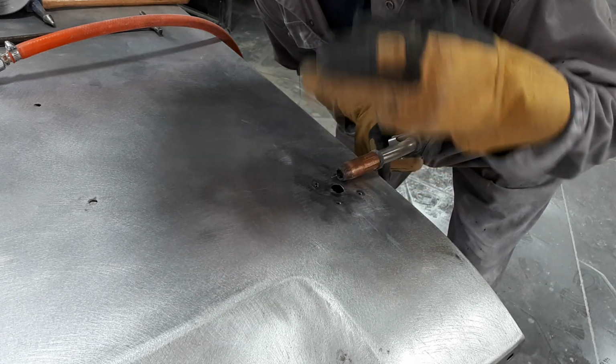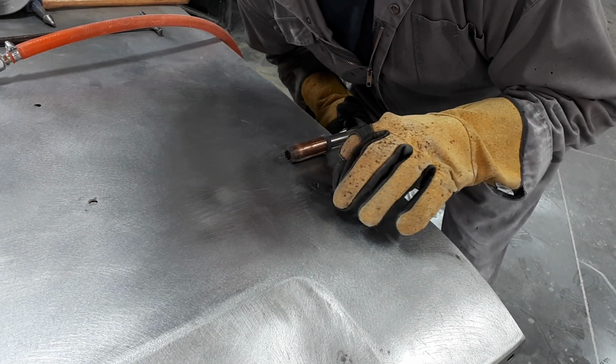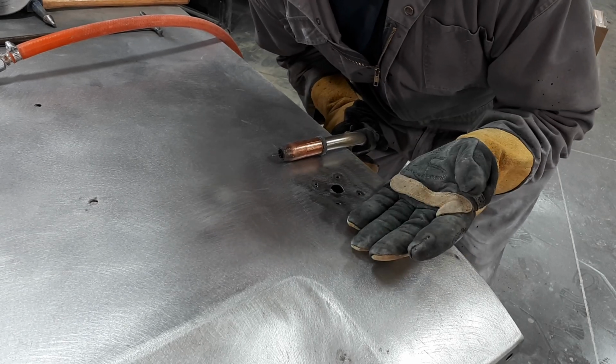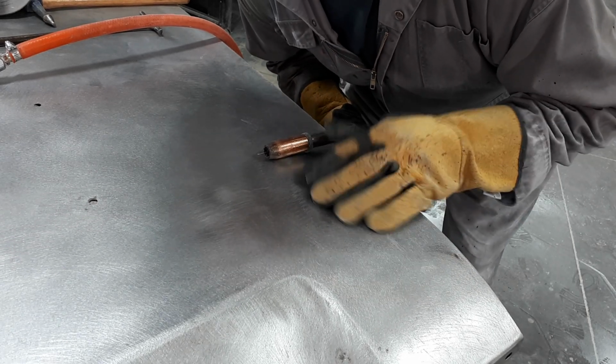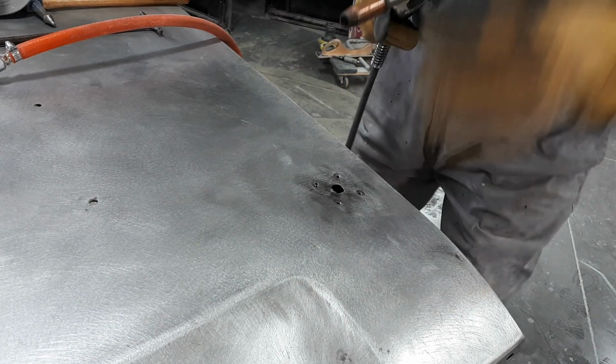So if you go in from the side, as sideways as you can in this kind of process, your weld's going to be a little more sideways. So you're going to have a little bit of keister of your weld hanging down the bottom. There's going to be a little butt on there. And so when you grind the top off, you still have some junk in the trunk underneath. And that's what we're looking for.